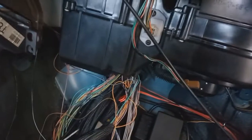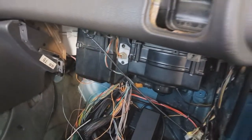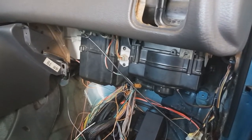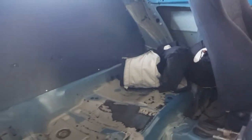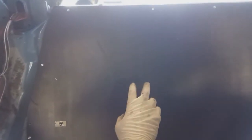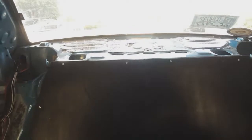The heater box is still hooked up, heater controls still work, so I still have defrost and heat if I need it — no air conditioning obviously. The car is fairly gutted; most of the sound deadening is out. The back seat is out. Outside of my race gear — my helmet and jacket — there's basically a firewall panel back there. It's not aluminum; I believe they call it Diabond — it's aluminum-sheeted plastic acting as a firewall from the trunk to the cabin.